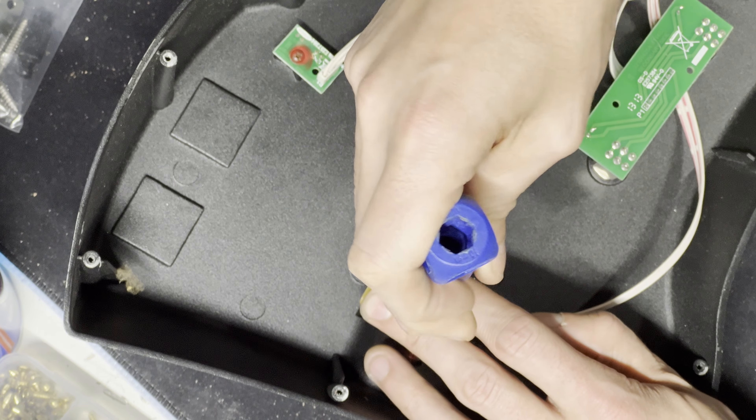So we did work on the one on the right. Check this out — if I just apply a little bit of force, nothing happens. I can put it all the way up and it doesn't do anything. But when I apply force, check it out — the light turns on. It's on the wah pedal. Now it's off. On. Off. Just barely pressing it — nothing. I can successfully turn it all the way up without it activating. Simulating some drummer next to you, right? It's shaking, got loud bass going on. Nothing. Use your foot and hit it. There you go. And I'm not exaggerating — that actually happens with this. Before I made this adjustment, the bass player's amp and the drummer were actually making the switches turn on and off because they were so sensitive that the vibrations were causing the switch to engage.